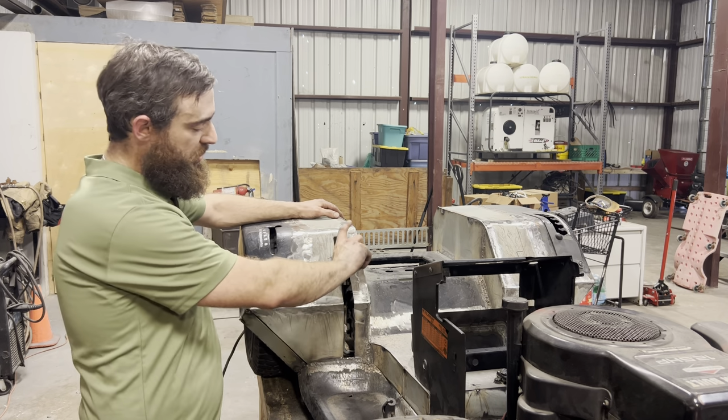And to get those 4 inches and still keep this same top, I'm gonna cut it closer to the bottom. Then I'll add in an extension of this rod and then weld the other side back on the top. All right, got the brake lever extended. Let's see how it works now. I think that's perfect right there. And our handle is gonna go down to about right there. So I think that's plenty of room for movement, braking, all that good stuff.